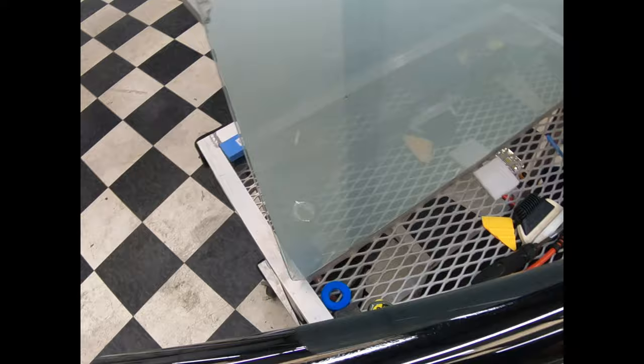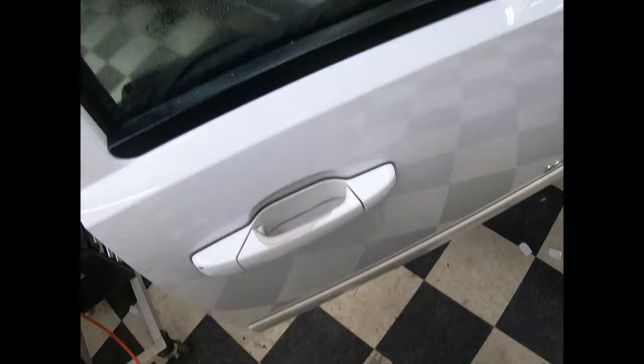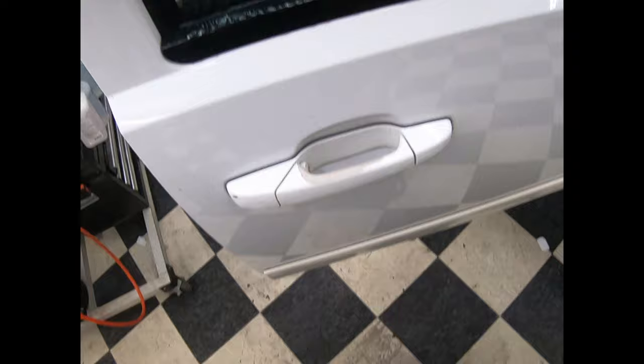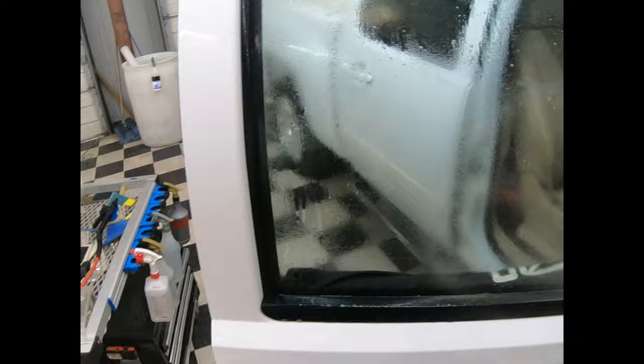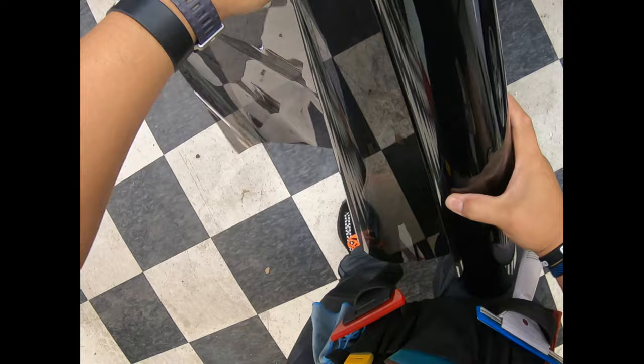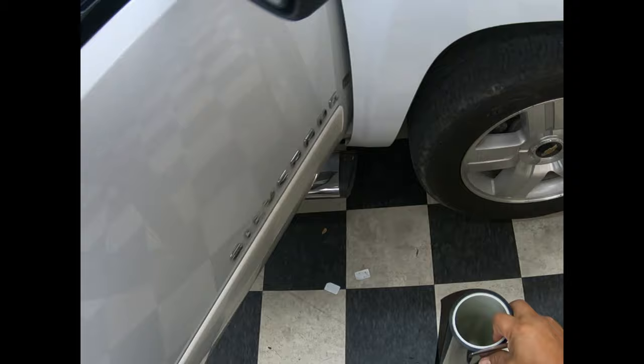Carbon film. This type of film has very aggressive adhesive and I'm going to use a special type of slip solution to handle this. I saw yesterday on the Facebook page somebody was tinting a Range Rover and the film was sticking on to the glass, having a hard time with that hydrophobic coating. We're always trying to use magical liquids to handle hydrophobic coatings and techniques. So that's going to come into play here today too — I'm going to use a special slip and technique.